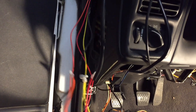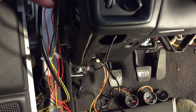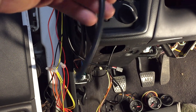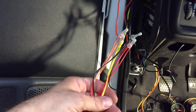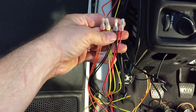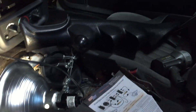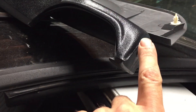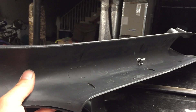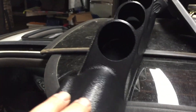I got the rest of the wiring through - there's my wideband gauge wiring, the fuel pressure wiring, and the hose here for the boost gauge. This three-gauge wiring connector kit they threw in is awesome - it cuts a lot of time off the installation because it's all color coded and wired up. I have to customize the pod pillar a bit though - grind back the molding on the edge and drill holes to snake the wiring up through.